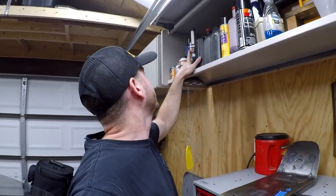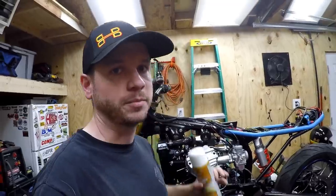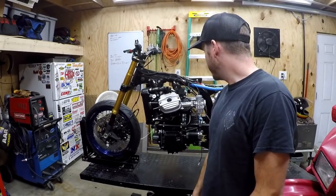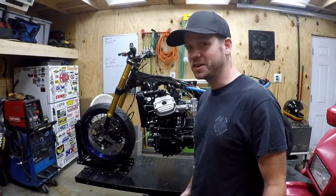Now, I am no expert on this, and like I've said in other videos, if I use it, some people are gonna be like, you shouldn't have used it, and if I didn't use it, people are gonna be like, you should have used it. But anyway, it's a Permatex 80697, just copper spray gasket. But meant for a high temp scenario such as a head gasket. But I figure if I'm doing it once, I just want to do it once, and I'll just spray it and we'll go from there. So hopefully they won't leak. But yeah, that about wraps up the entire cooling system, all the components on the bike, and this thing should be pretty rad. So I'm excited about it.